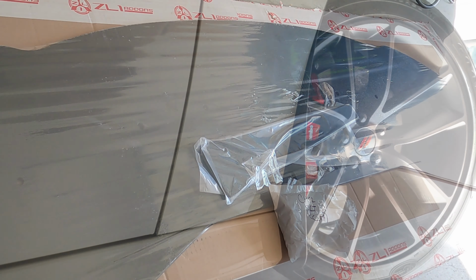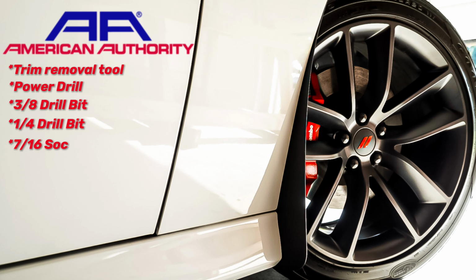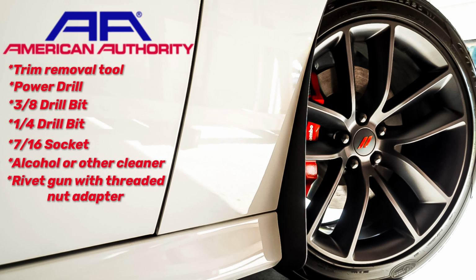You're going to need a trim removal tool or a flathead screwdriver so that you can remove push pins. You're also going to need a power drill, a 3/8 drill bit, a 1/4 inch drill bit, and a 7/16 socket. You're going to need some alcohol or any other type of cleaner to prep the area before applying the 3M tape. And most importantly, you are going to need a rivet gun with a threaded nut adapter.